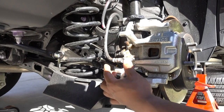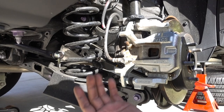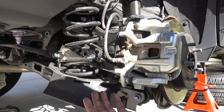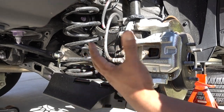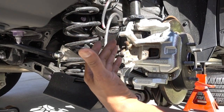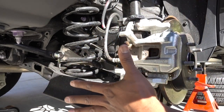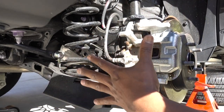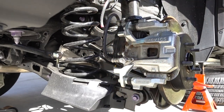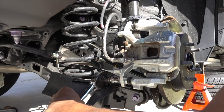This truck is brand new so I know my pins are lubricated, but when you do a complete job make sure that your pins are lubricated — put new grease on them and make sure that they slide properly. In my case I'm just showing you the electrical part. I have other videos in the description showing how I do rear brakes on my Honda Accord and my Subaru. Torque the bolts down to 20 foot-pounds.